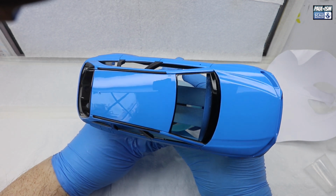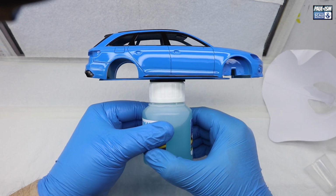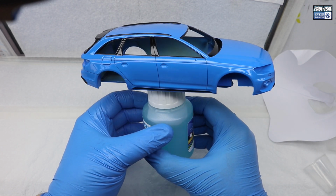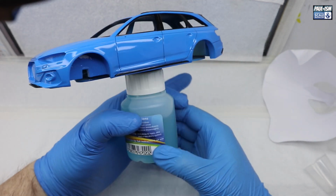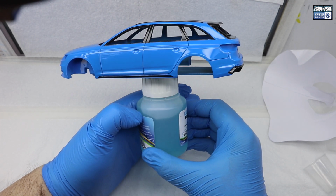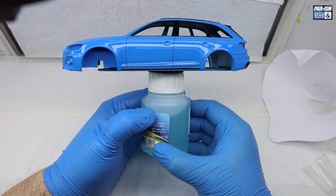This has been put back in the case for another couple of minutes. I've just pulled it out to have a look. And there's no orange peel. You can just see some ripples. And I know it'll self-level out, so I'm going to leave it alone, where it's just not quite perfectly smooth. I know the self-leveling effect of 2K will take care of that.